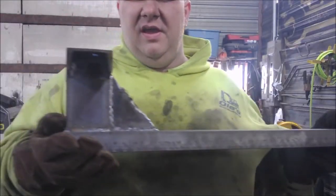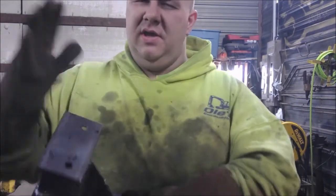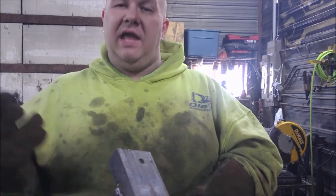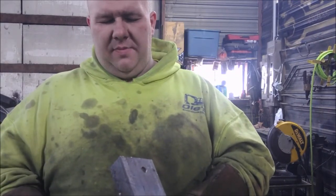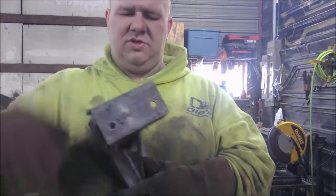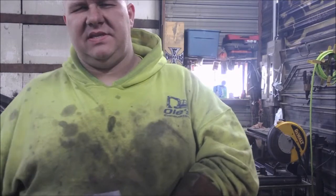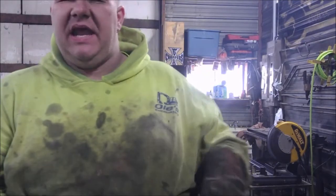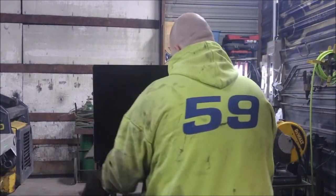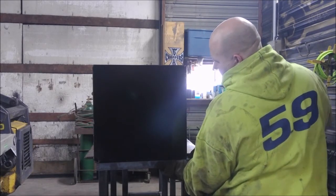Here's the bracket I came up with for the back, driver's side, the back portion of the box. Normally it would just be a right-angle bracket that would bolt right here to the side of the box, but under there is the spring hanger mount, the emergency brake cables, and a cable mount — so there's just not room. You also can't get it far enough back to put a diagonal brace on it. There are two existing holes in the bottom of the frame which those match up to. This gets the drop we need with some gusset action. The other end will be able to have the big 90-degree piece with a strap for extra support. For this end, this is just going to have to do. It will be spaced away from the body and the frame, and it will bolt on regularly.